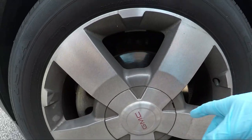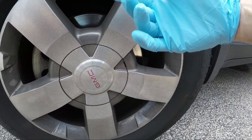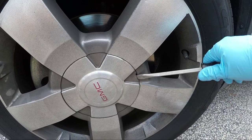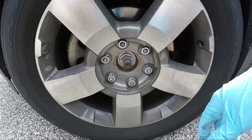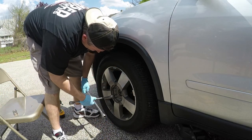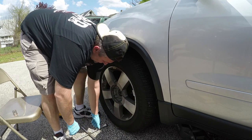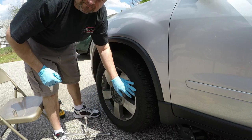What we're going to do is pop the cap off the cover here to get to the lug nuts. I'm going to loosen the lugs first, then get the car up off the ground — doing one side at a time. I'll grab my tool cart. Try not to screw up your paint on the wheels. You can see it's a six-lug axle — fairly straightforward. I busted the rest of the lugs loose using a 7/8 inch socket. May not be the exact right one — probably closer to metric — but it's getting the job done. Now I'll get the car up off the ground.